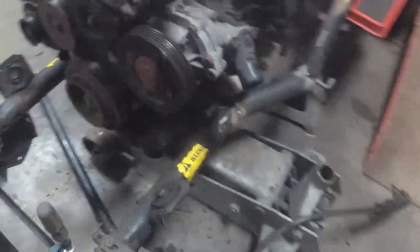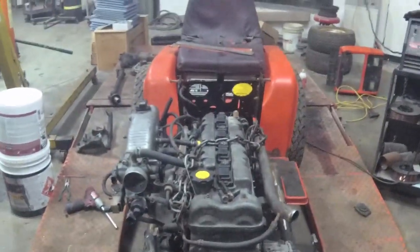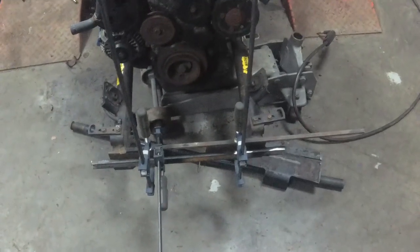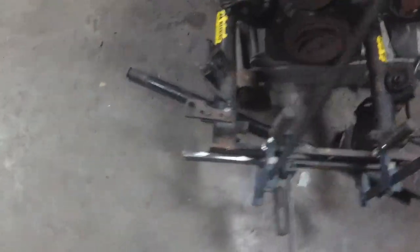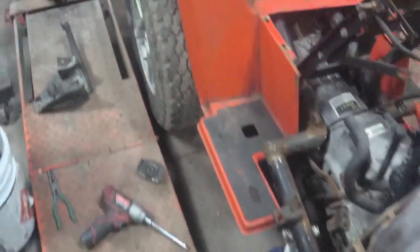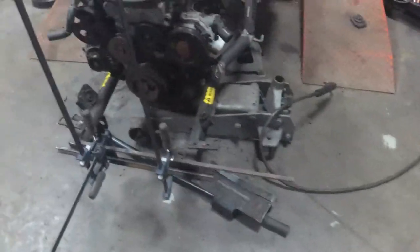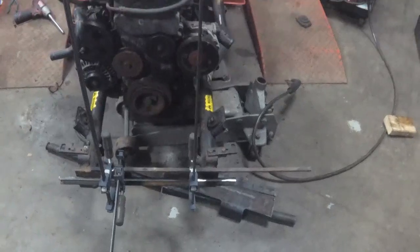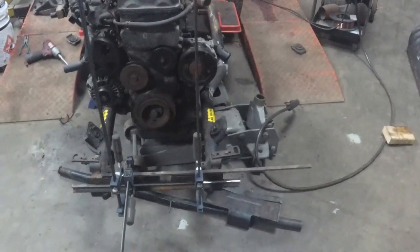Alright, I got it mocked up on both sides. I'm just trying to align this frame so the middle of this is centered on the frame — so we don't do a crab walk. We don't want that. I am just measuring from the motor mounts to the tire, right on the edge, on both sides, and we're going to try and get it the same so it's at least aligned. It's shifted this way a half inch, but you can't tell by the motor because the oil pan area is offset.